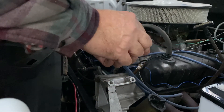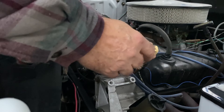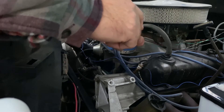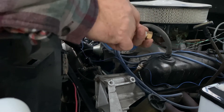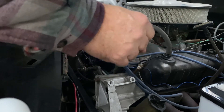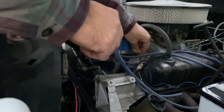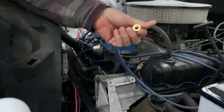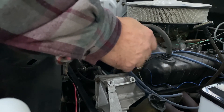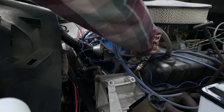This is the bushing that comes with the dash kit sensor. This is a 351 Windsor — my temp sensor is right here. Here's my old one and here's the new one that I actually had to go buy at Lowe's — these are about four bucks each. The one they send with the kit will not fit mine, so keep that in mind. The instructions say do not use any pipe dope or Teflon tape — that's against my better judgment but I'm going to follow their instructions.